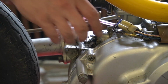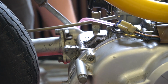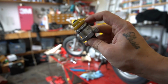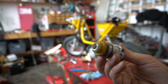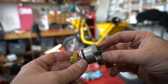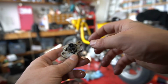Nailed it. Well, I guess that white plastic piece was supposed to come off after that. So what I got here is the oil pump. This pulls oil somehow in here and shoots it around into the carburetor, I guess. Anyway, I'm going to take it off. I'm going to take off this gear and use this thing as like a plug, basically, because I'm getting rid of this oil injection. So what we'll probably do here, pull this off, pull the shaft out, make a plate to go there.